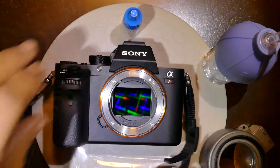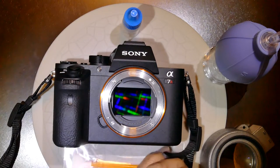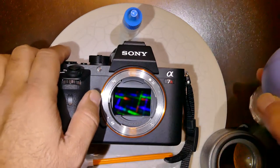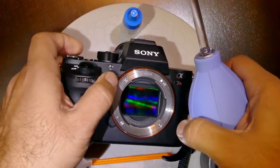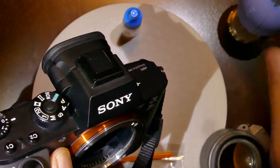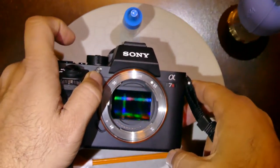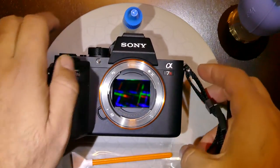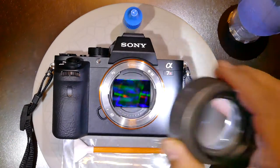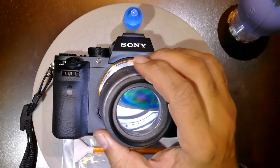It's not compatible with their water-based cleaning solutions. To start, make sure you do a couple of puffs to remove any gravel, microscopic quartz, or anything on the sensor — you just don't want to squeeze anything onto the sensor while swabbing. Do the inspection prior to swabbing.